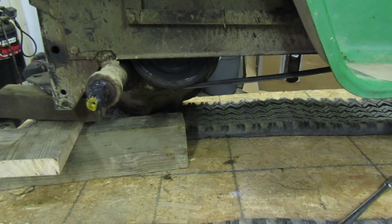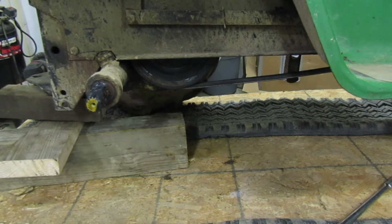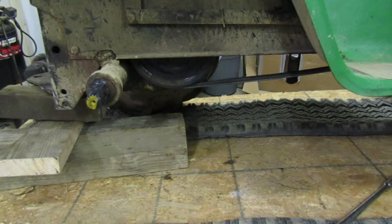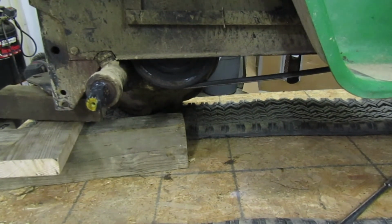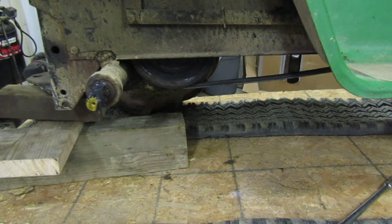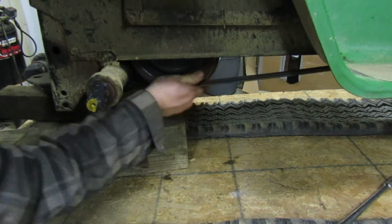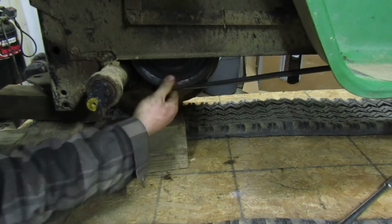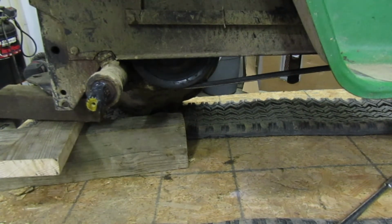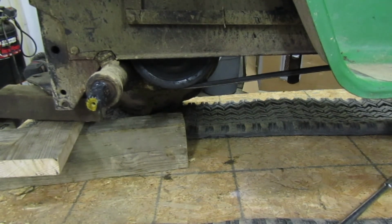There you go. So let me pop it in. Actually, it's out of gear, that's why. Let me, no. Hold on a minute. Why isn't it? Oh, I see why. That should be. So why isn't that turning over the motor? There we go. Pulled all the way back. Alright, we're going to have to adjust the variator since I'm thinking about that. So, let me get this wheel put back on here and then we'll adjust that variator.